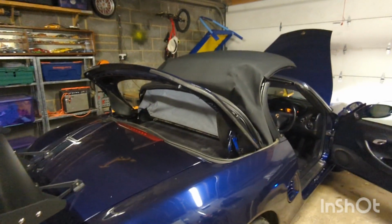But get the car into service position. Come into the back of the car. Hopefully we're going to see this okay for the light, or lack of. But just in the shadow there is your drain hole. You can put your finger down it and then you can actually feel where it's supposed to go. Any water that comes down the roof ends up falling into the drip tray there. And then the other one is in exactly the same position, just on the other side.